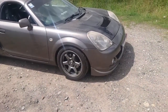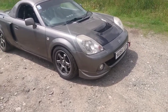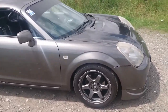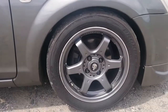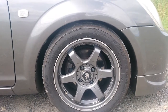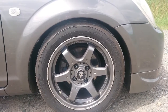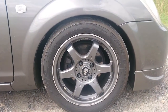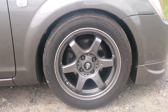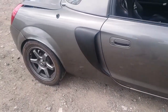Okay then, so we've stopped, so a bit of a walk around. I'm not sure what the light's like in this, quite sunny. So front of the bumpers, standard sable grey, front spats. The wheels are WKS Engineering monoblocks, so like an Enkei copy. Same size and fitment as the facelift wheels on the MR2. Currently got R888Rs on the front and AR1s on the back. Next track day they'll be changing to AR1s on the front too. Brakes are blue stuff pads. Suspension wise, we've got Maestro coilovers, C1 copy scoops.